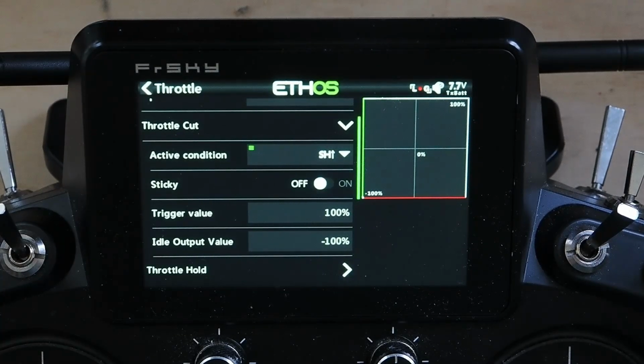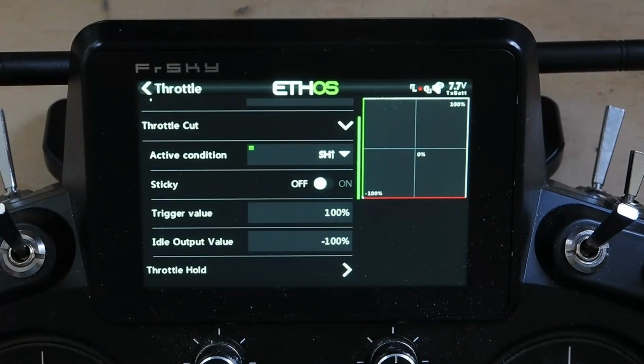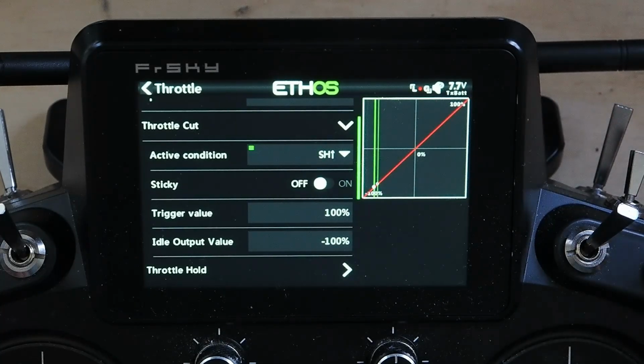So right now we're ready to actually do the initial servo setup of the engine, because you've got your throttle cut, so your carb barrel is fully closed. I put the servo into this condition, set the servo so the carb barrel is fully closed, and then I set my max throttle percent so that there's no binding at 100% and the carb's fully open. So that's the procedure. Set carb closed and then adjust the output, the max value, for carb fully open. That way you've got the most linear throw.